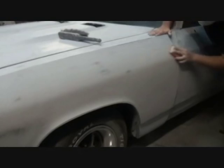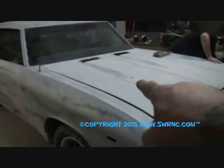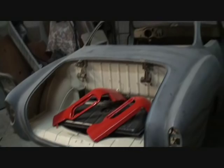So we basically just started on this. Today is actually the day before Thanksgiving. I will be down here tomorrow sanding this car, because we want to start dismantling it and start painting it. I'm getting excited to start painting it. When we get this blocked out and ready for paint, we're going to remove the doors, the fenders, the hood, and then this piece right here, and paint all those separate. The first thing we're going to paint is the body shell itself. That way, when we paint the doors, hoods, fenders and this piece here, we'll be able to color sand and buff them and directly bolt them onto the car, so they aren't sitting around collecting dust waiting to be installed.